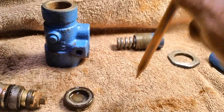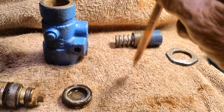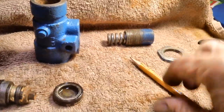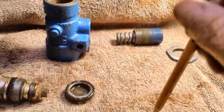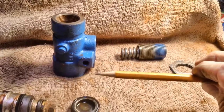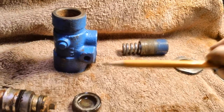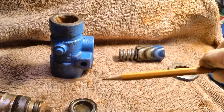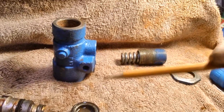There's 2 pistons on each side of the car. Actually, there's 4 pistons, because they're all independently operated. So you've got 4 pistons on each side of the car, stopping this almost 2.5 ton car, 2.25 ton car, when it's going along at 60, 70 miles an hour. So you want those front brakes to grab first, so the fluid comes directly there.